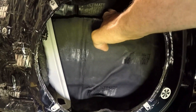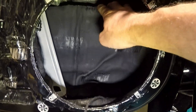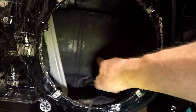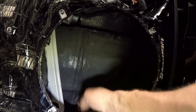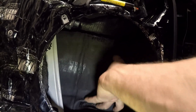Then the ultimate material is put on the top side and hung down over the brace. There are voids in here, and the reason I'm hanging this is to deal with acoustical reflections. The energy goes into the material — through the foam first, which lowers its resonance, then through the deadening material, which lowers it even further. That pretty much washes it out. There's a void between the two surfaces, and then deadening material on the other side, so we're capturing and dissipating energy inside the door as best as possible.